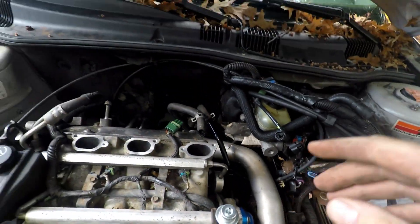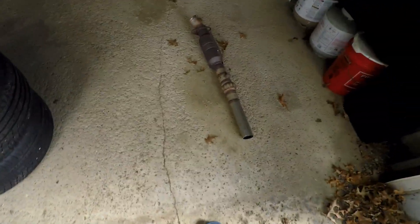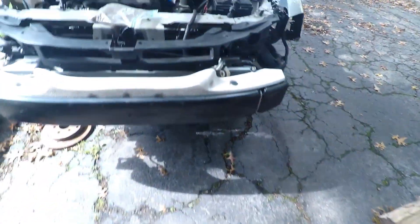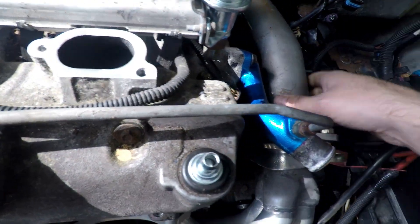With this connection and then the connection on the downpipe, it's like a ball and socket kind of thing. You just pull the two sides together - one side is flared out, the other place is flared in, it just kind of sits there and it can pivot a little bit. So no need to worry about gaskets.